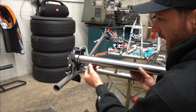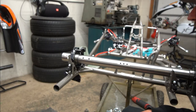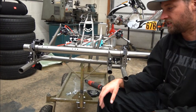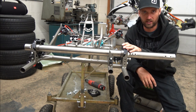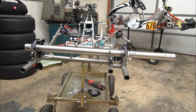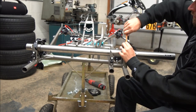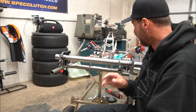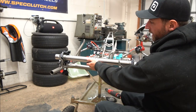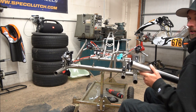With the bearing centered, it's seamless — fits perfect and the bearings spin super free. This side of the bearing is now done, this carrier is complete and centered. I'm going to take an Allen wrench and lock this set screw down. Now I'm going to take the axle out and go from the other side. This bearing's pinch bolt is still loose — pull the axle back out and start from the other side.